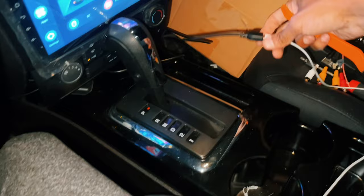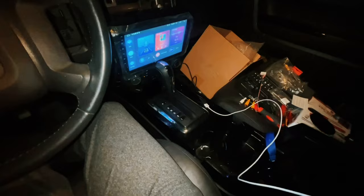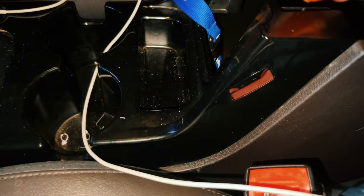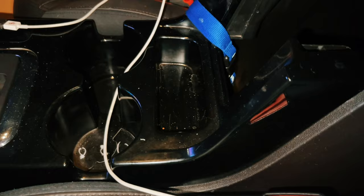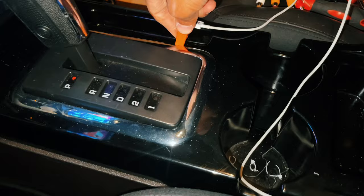My goal is an OEM kind of look. These two USBs come with the radio kit — I'll be routing them through here so I can plug them inside the compartment. I'll be taking out that panel, which is super hard to take out because you have to use some force and it's going to sound like it's breaking, but it's not. You can skip this step if you don't want to use USB, though it's faster for Apple CarPlay. You can also use it wirelessly if you want.